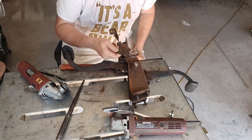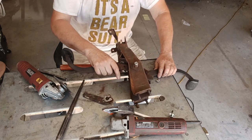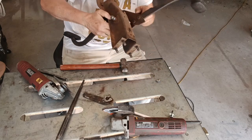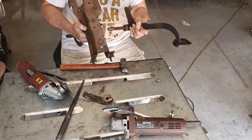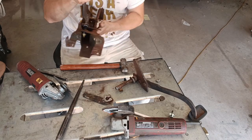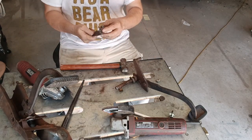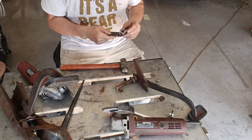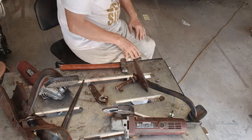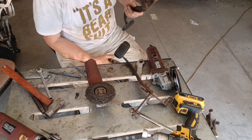There it is off. If I pull the clutch pedal out, this brake pedal should come out — it does have a spring. You have to take this out to get it out of here. I'm going to do a little bit of clean-up on this, and probably take a lunch break. What a mess. With the brake pedal out, I can go ahead and clean that mess up.